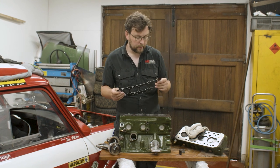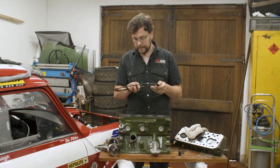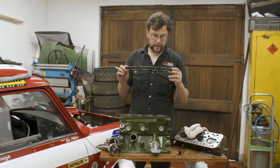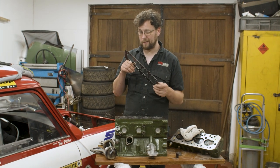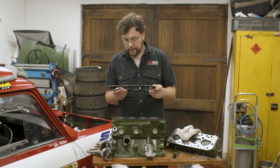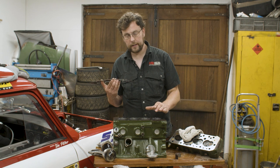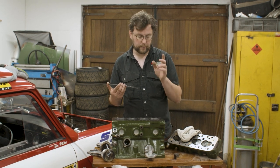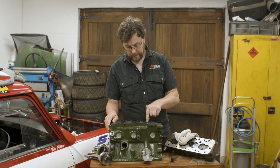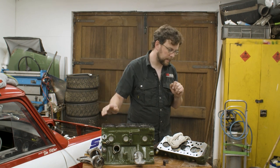This is the multi-layer stainless steel gasket from Mini Spares, very similar to the Cometic gaskets I've used over the years — I suspect this may well be made by Cometic as it looks identical. There is one thing I need to tell you about these gaskets: they require an incredibly high quality surface finish to work properly, and I'm going to show you the failure mode. I took a gasket off another customer's engine where I know the surface finish wasn't good enough.